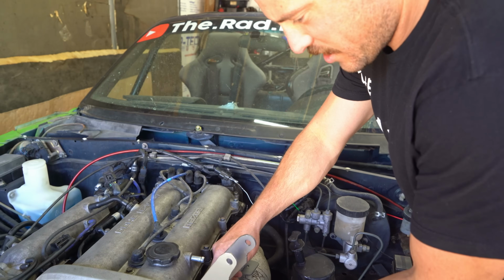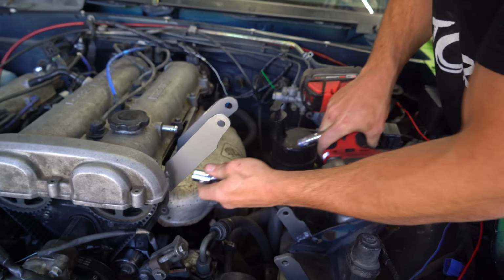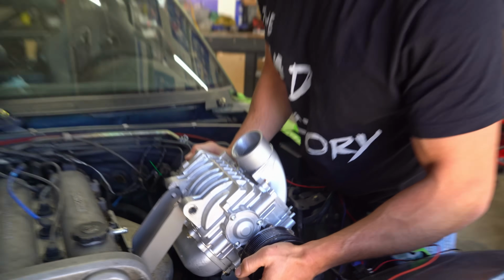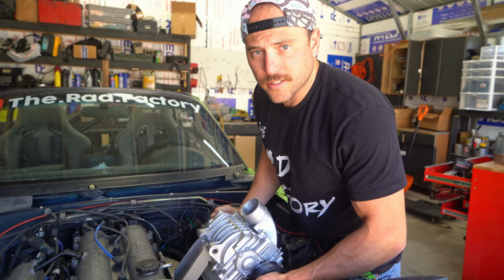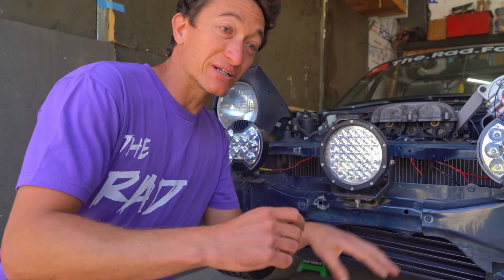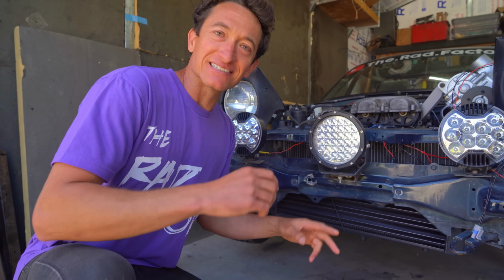It's a weird supercharger that's not designed for this space, and I think it'll work anyways. As you can see, the next step, we have to figure out our inlet and our outlet, because right now, nothing is pointed in the right direction. Unlike last time, we're running everything through an intercooler, so just in case the plastic rotors explode, this should filter everything out before it hits the motor. It'll also cool the air down and make us more power, but that's a secondary purpose.